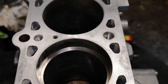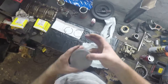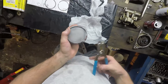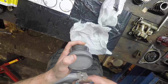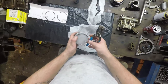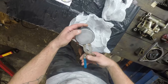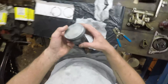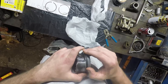I'm going to bang the rings on and then start putting the pistons in. Here we have the piston rings - the M54 ones. The bottom ring is the one that's debatable; lots of people make conversations about them not being any good because they're a two-part rather than a three-part ring. I've decided to go with them - whether or not I've made the right decision will come through in time, but I believe they're probably going to do the job perfectly if I bed them in correctly. With the bottom ring, the easiest way to put it in was to put the spring into the ring gap first and then take my piston ring expanders and just pop the ring around it. You put the bottom ring on first, the middle ring and then the top ring, making sure you spread them out as wide as you can. You don't want to scrape the side of the piston as you put these on or you'll create a weakness or a point for failure.